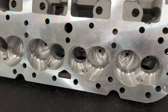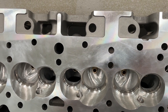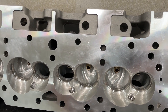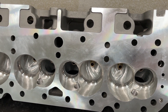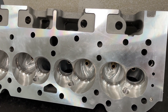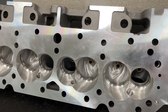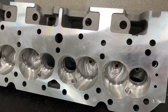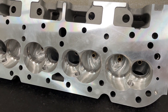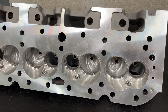That's quite a bit different. On most of the stuff I port, because it's for racing, it's a 50-degree valve job. What a 50-degree does versus a 45 is the 50-degree wears out a little quicker, although I've had some that lasted a very long time even in circle track stuff. But the 45 is supposed to last longer. The 45 also flows better at the lower lifts, and the 50-degree flows better at the higher lifts — hence why most of the time I use a 50-degree valve job. This customer specifically requested a 45-degree valve job.